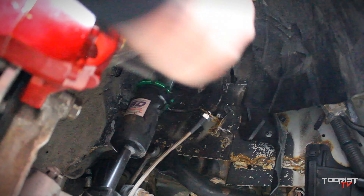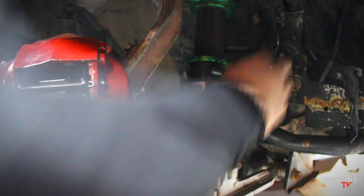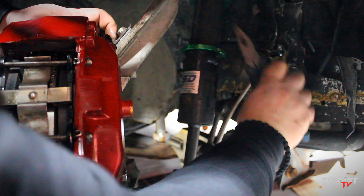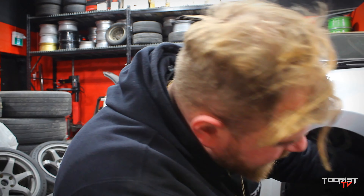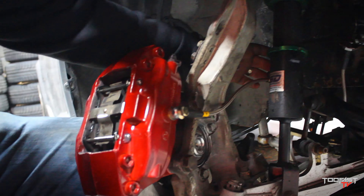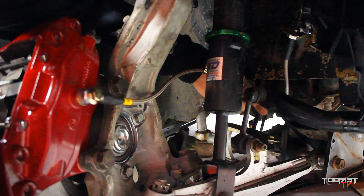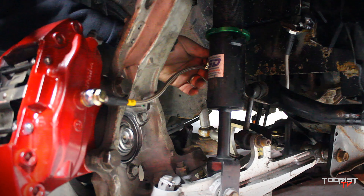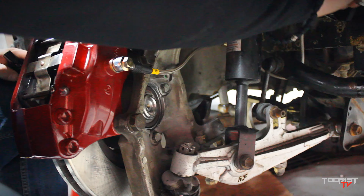Now what I'm going to do — I'm gonna grab this clip right here. L-side facing upwards — you see that clip? This clip right here, L-side going upwards. You see, it'll sandwich right in. Put that in, give it some love taps. So what we ended up doing — we routed the brake line, we played with it to see what would be best for us, especially for the amount of angle we'll be running. The bracket will go to the coilover itself and then run straight down right behind the sway bar link. We'll probably run another zip tie somewhere back here just so it doesn't ever interfere, and it'll come straight up to the OEM brake line. We grab our special tool — the brake line wrench, 10mm side — and go ahead and tighten that.